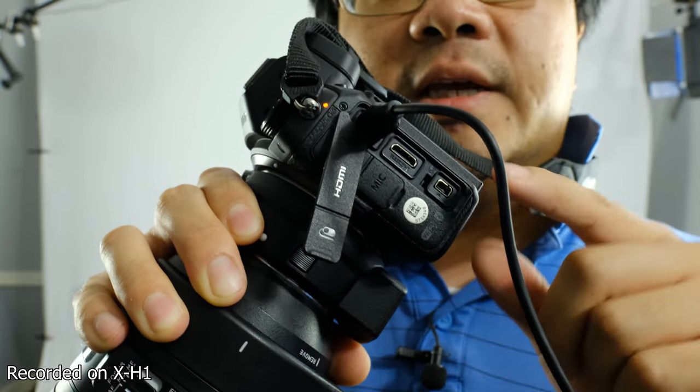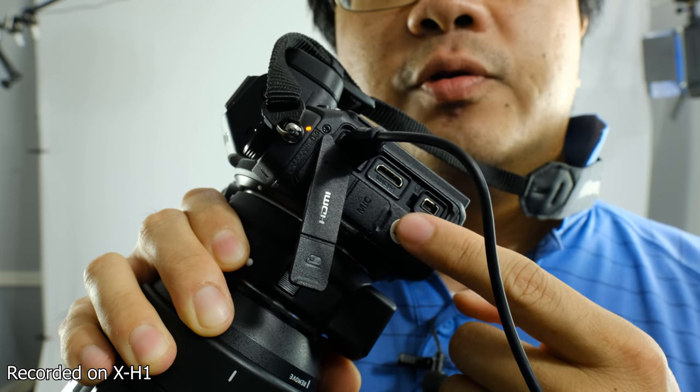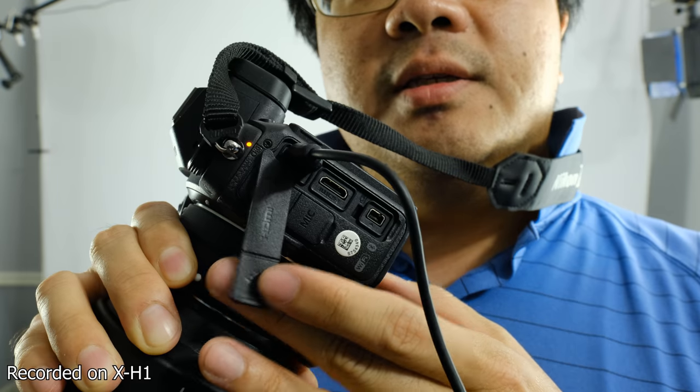One caveat: if you use USB charging throughout the day, it's actually bad for your battery because lithium-ion batteries don't like to be quickly topped off a little at a time. They much prefer a deep cycle — charge all the way up, drain to about 30%, then charge all the way up again. Constantly topping off in mini cycles will severely reduce battery life. These are expensive batteries, around $70, so be mindful of that.